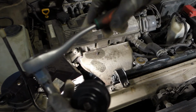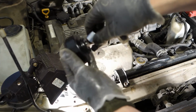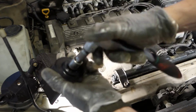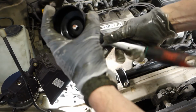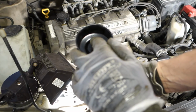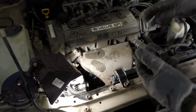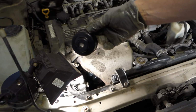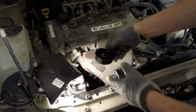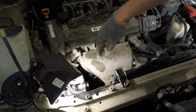And we also need a wrench, and there is this socket that fits in that hole in the central area, in that way. And then we can rotate our wheel, and I insert that socket in here. The idea is that when I move my wrench, this part opens this oil filter. And this oil filter size is 65 millimeters inside. Okay, and first I need to of course insert my filter into this filter opening tool. The idea is that there are corners inside, and these corners make the right contact with this oil filter.